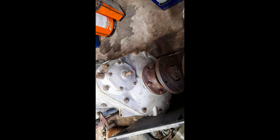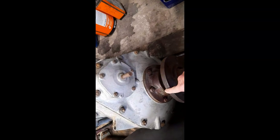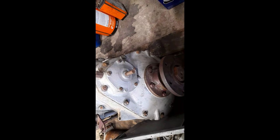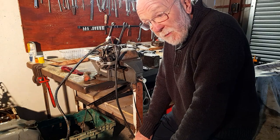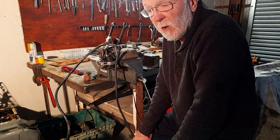It's particularly easy if you've got a Gardner gearbox. Here we've got a classical 2C Gardner gearbox — a mechanical gearbox. If you can get anything onto the flange at all — a nail bar, a big screwdriver — you can rotate the engine that way easily enough, with the gearbox in gear of course. The interesting thing is that with a Gardner marine gearbox on a boat, you can actually tow-start it: put the gearbox ahead, tow the boat, the propeller is rotated by the motion of the water, it'll rotate the whole engine and the engine will start. You can't do that with a modern hydraulic gearbox.